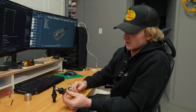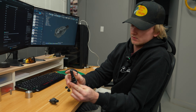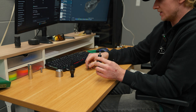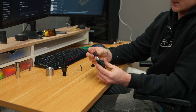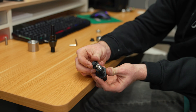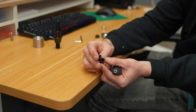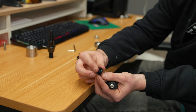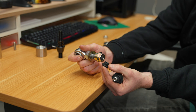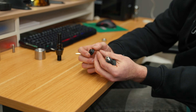The reason we had to come up with something like this is because Joel was working on the 350 — when he went to do full compression under the strut, this piece was hitting the top of the wheel well, so it wasn't going to work. When you lower your car, you need full range of motion. We came up with a more compact design: basically a through-nut design, similar to our smooth adjusters here in the shop — an M10 smooth adjuster that goes onto a bearing instead of a heim joint. It'll all be out of stainless 17-4, a high corrosion-resistant material for Canada.